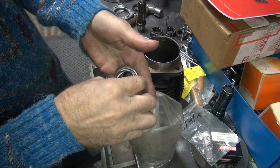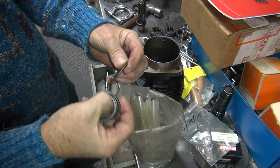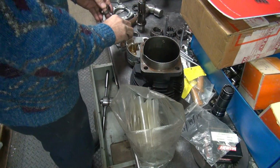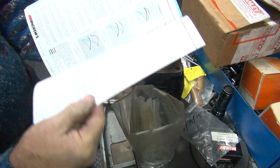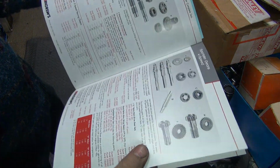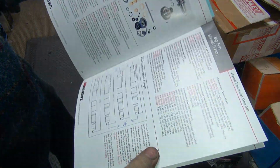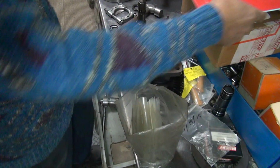And we'll just grab some of these, see how much we need. So we just stack these things up on the crankshaft, and there you go. Should have what we need. So I can just figure out how much I need, and that would be in the book over here again. It's 4 something. That's Sportster. 485. Just under ½ inch.